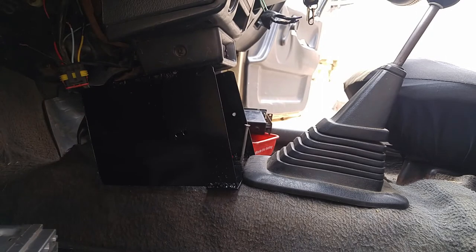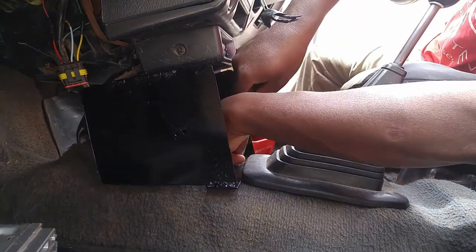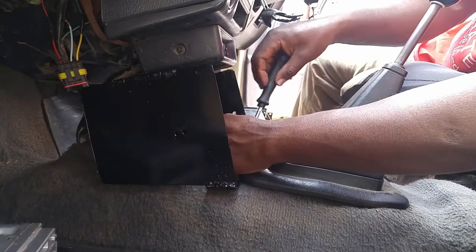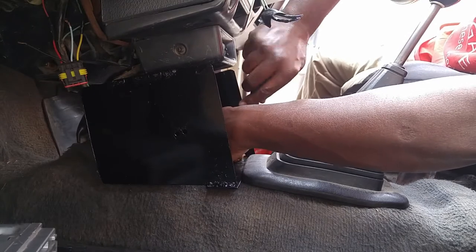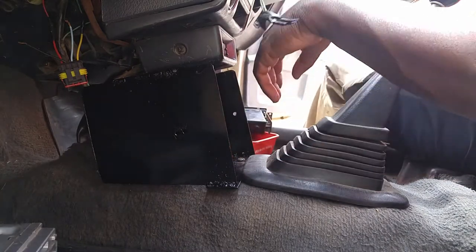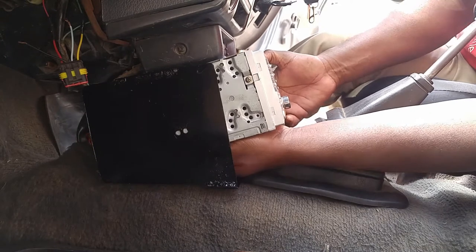Already fixed it in the car and it's fitting very nicely. Putting on the screws to hold it tight to the car body, which will also supply the grounding for the stereo. Making sure that it's tightly screwed to the car body — it's just beneath the dashboard. That looks good and it's holding very nicely. Now fitting the stereo into the frame and bolting it up.